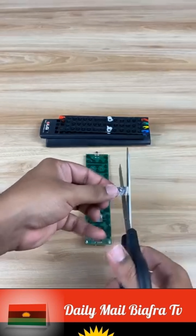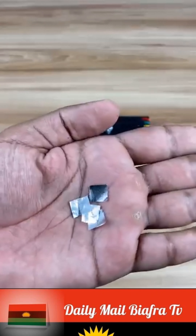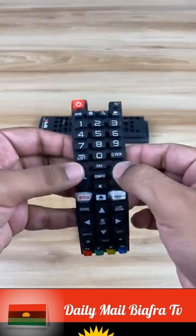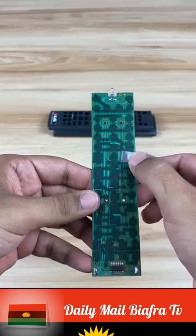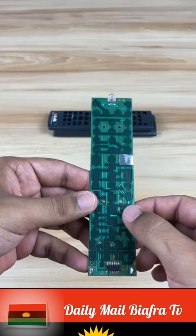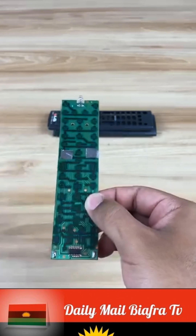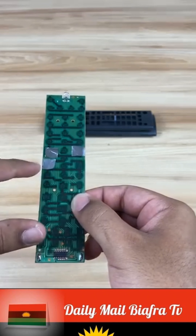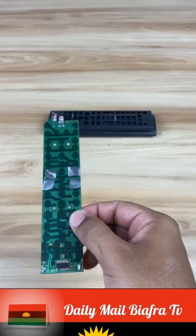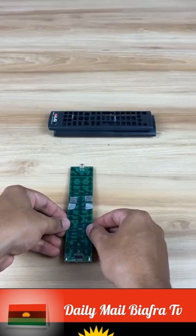Aluminum is an excellent conductor of electricity. Once the aluminum is cut, we place the foil on the buttons that weren't working. We know which buttons aren't working — they are the volume and channel up and down buttons. We place the foil as shown on the screen. It's important to ensure that during this process, the aluminum doesn't touch any other button, only the one that isn't working. For this reason, the cut must be more or less precise.